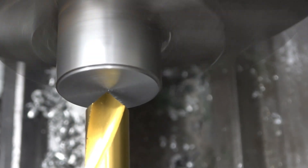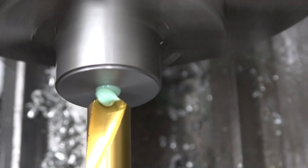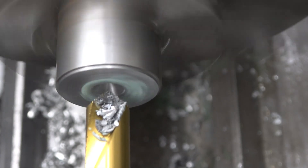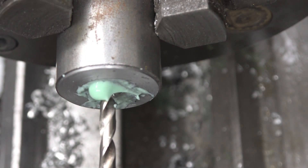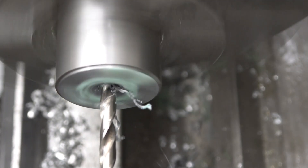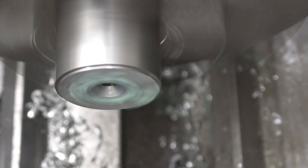I've purposely put the drill chuck in so that the flute of the drill is at the top, which means that the swarf will be ejected exactly where it's needed. And that really is like a knife through butter. So that is the proper spot drill - we'll put an ordinary drill in behind it. First class, very happy.